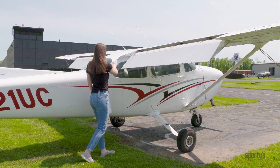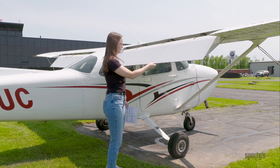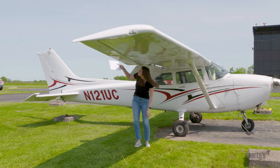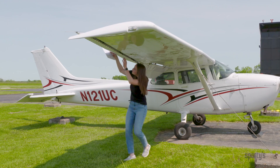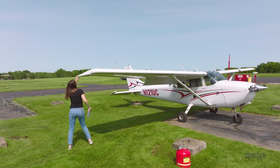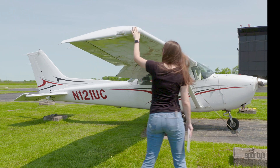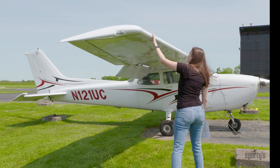After moving down the right side of the fuselage, check along the flaps — the upper surface being easier to see because they're down. Gently examine the aileron's freedom of travel; control surfaces should move easily using only two fingers. Scrutinize the wing tip, navigation, and strobe lights for apparent damage. The wing tips are especially vulnerable to being struck by other aircraft and vehicles.